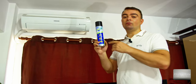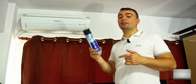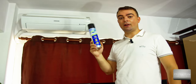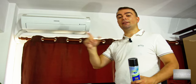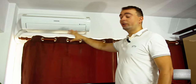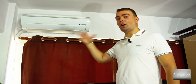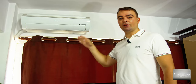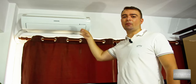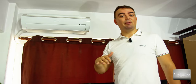You will use a foam spray — you'll find it at specialist stores where they sell air conditioner units. It comes in a tube that you spray from 10 to 20 centimeters from the unit. It covers the aluminum radiator and you leave the fan running to suck in that foam, which gets rid of the smell caused by bacteria inside.